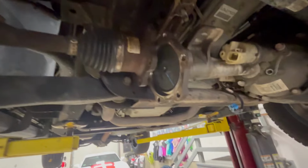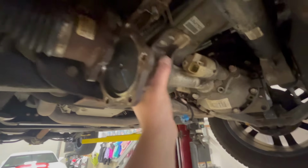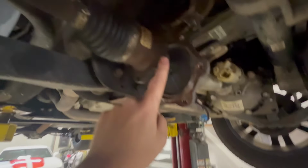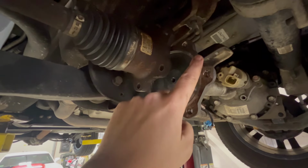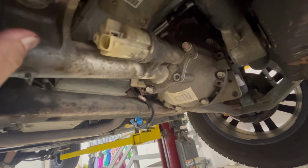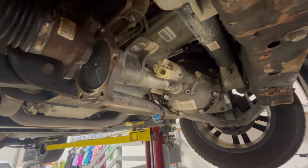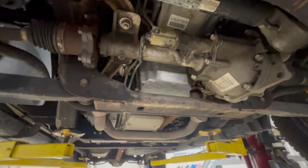As you can see, it is tight. When you undo these 2 nuts for this axle and you pull this down, you get just enough play to line up this ear into the center of these 2 ears, and it'll be just enough to get this out of the way. But now I just released some of the tension, so now I can feel if this is going in by hand or not, which you can see as I'm wiggling it. It's nice and loose. I'm not gonna force it in, and I'll torque these bolts down. And I'll throw the bolts in for these two faces, tighten that up, fill it up with oil, and we'll be good to rock.